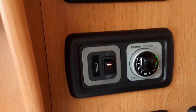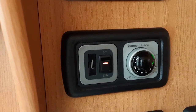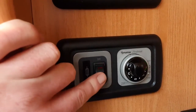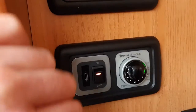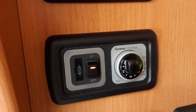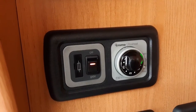Above that we have a similar system for the heating on board the caravan. The two switches here are for the 230V mains side of the on-board heating system. The switch on the left-hand side needs to be on to put power to the switch next to it — when you turn it off the green light disappears, turn it back on and the green light reappears. Down the side you'll have 500, 1,000, or 2,000 watts, which relates to the amount of power coming into the caravan from the site. Select the correct power source and you can control the temperature of your heater on the dial in the centre between 1 and 9 — the higher you go, the hotter the heater will be.